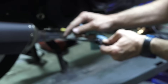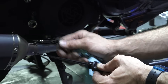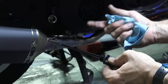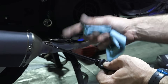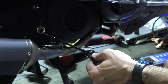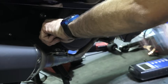All you see is the cross-hatching of the dipstick. If the oil's right at the tip, it would take about 200 to 250 cc's of oil. One thing with the Primavera and Sprint — they're pretty difficult to fill. We have a special funnel that makes it easier. Another option if you're just topping off, you can use one of the syringes we sell — 60 milliliter syringes — so you can give it a couple accurate squirts of oil. This scooter doesn't need to be topped off; it came out perfect. I recently did an oil change on this bike, so there's no issue there.